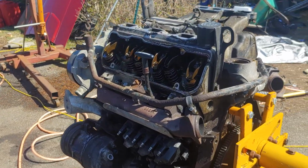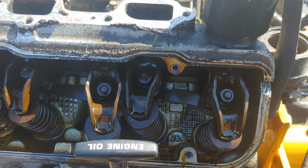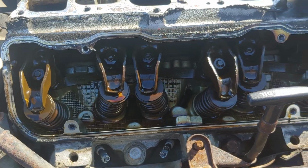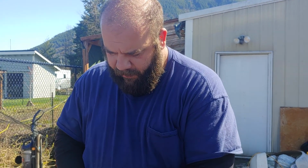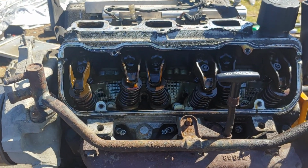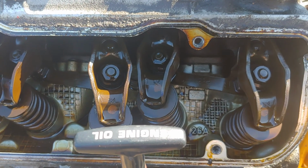So now you can see the layout of the valves there. And I was reading in the book this morning because I have multiple books on this car. You got to make sure the push rods go back with the correct valve, because the intake rods are exactly 6 inches and the exhaust rods are 6 3/8 inch. So that could be a major issue if you mix them up. So I'll make up a cardboard layout here in just a few minutes.